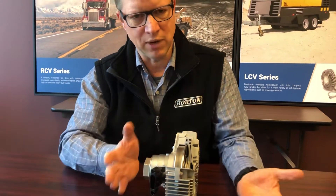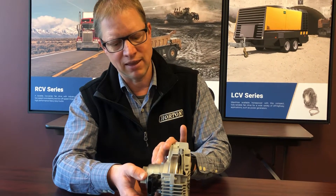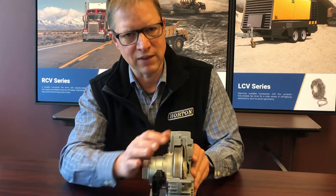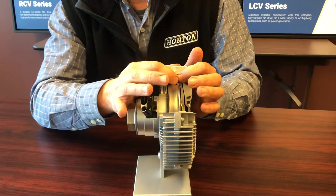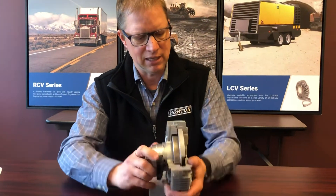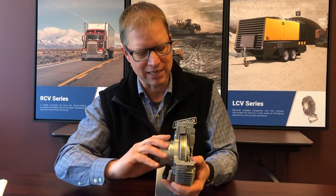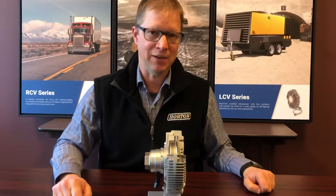Now, how the clutch works is when you want the fan to go into the on condition and start to rotate, there's a reservoir in here filled with a very thick, viscous silicon oil. When you want the fan to start spinning, it starts pumping oil out of this reservoir into these grooves. You can see they're very, very tightly tolerant, so it doesn't take much to go in there. And then this can no longer spin freely — that really thick liquid gets in between there and kind of gums up the works, so to say. It transmits the power from this piece into this outer piece. So when there's no oil in the grooves, the inner piece spins freely. This is still; the more oil you put into these grooves from a drop to full capacity, the more this whole thing starts to spin along with it. If you're visual like me, that really helps understanding how these work.